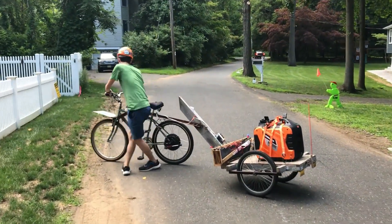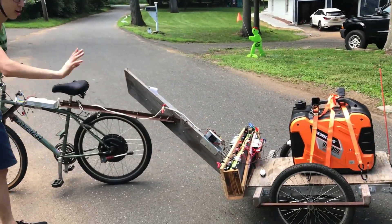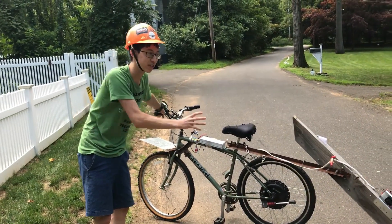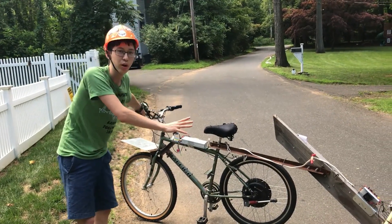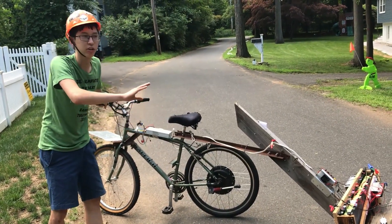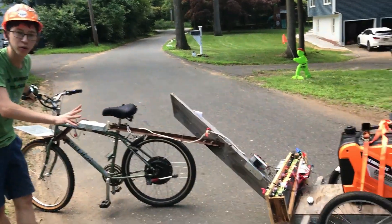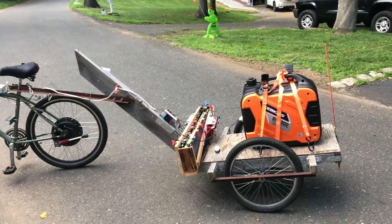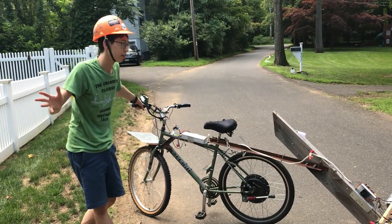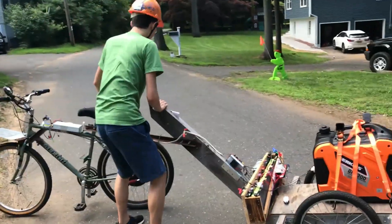Right now with this e-bike you have slower acceleration because of the added mass, and the top speed is 25 miles per hour on this system. The top speed is not a limitation of the design but of the voltage — if we had a higher wattage generator and another battery pack for higher voltage, you could go 40 to 50 miles per hour with unlimited range. Currently running at 40 volts limits you to 25 mph, but at 70 to 80 volts you could reach around 50 mph. Another option is you can run the e-bike without the hybrid generator.